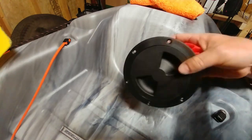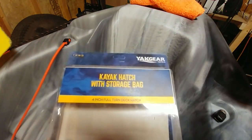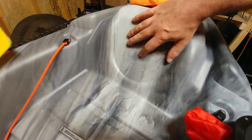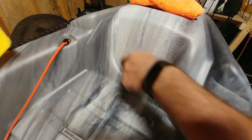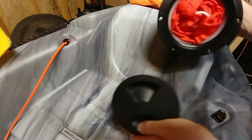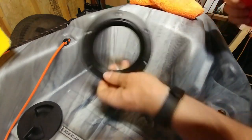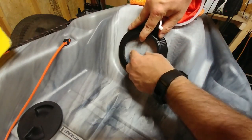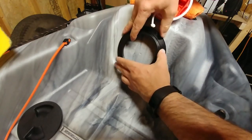Hey y'all, I got this hatch from Yak Gear - it's a four inch, part number Hatch 4C. The Pelican 110 - and I don't think the 130 does either - has no hatch in the front. If you have this kayak you already know there's an indent right there, and that's for the mold center point if you want to install the hatch. Make sure you have the four inch hatch - the six inch is too big, at least in my measurements.